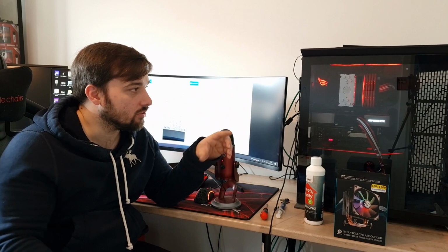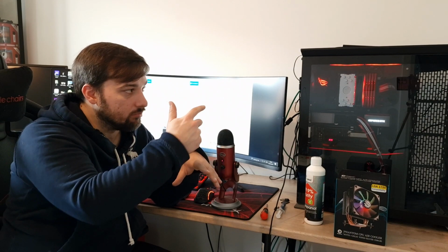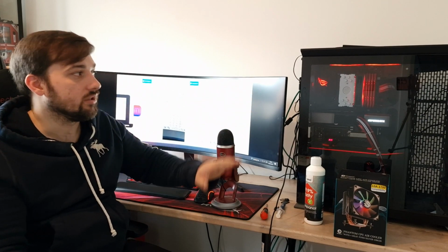And then the fan's really easy to install, which is good. It literally just slides on. Because it's slid on, it allows you to heighten it if you've got taller RAM. Mine doesn't go all the way down because my RAM's in the way, because I've got all 4 slots filled. If you've not got as many filled, you might get it all the way down, so it's flush with the top of the cooler. Or if you've got low profile RAM, then it should fit no problem whatsoever.